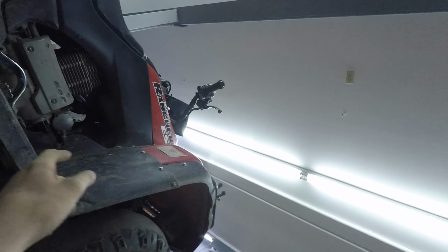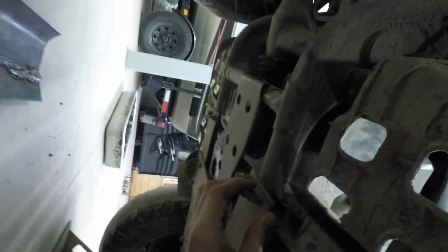So what I would suggest, if you buy an electric shift Honda, I would suggest making this skid plate to put over here. Now I'm gonna drill a hole there and a hole there, put a bolt up through it, and then I'm gonna drill this out, tap it on both sides and screw bolts into it there. So that's how I'm gonna do it, but I hope this doesn't happen again. It's a very stupid design by Honda to not put a skid plate here.